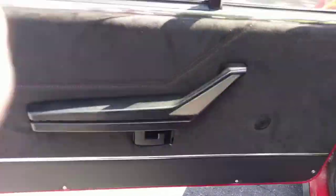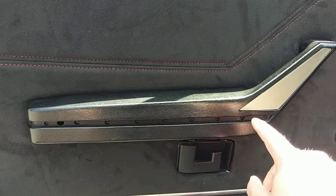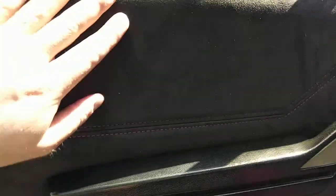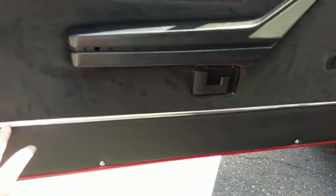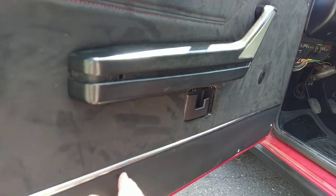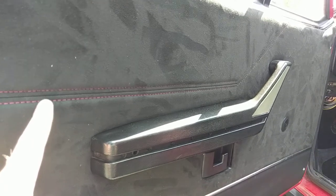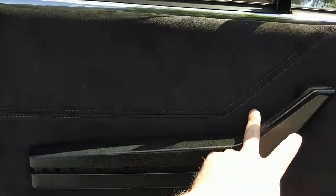They're not quite done — I've still got to find some nice replacement trim to go inside the armrest, thinking a nice chrome piece or something that'll run through there. The door skins use a reused chrome piece from the original, with new leather down below, and from the chrome piece to the top the door is all Alcantara. There's also a decorative red stitch that follows the original lines of the original door cards and runs along the length of the door — same on both sides.